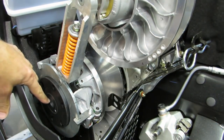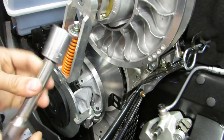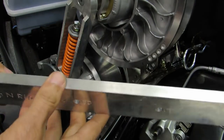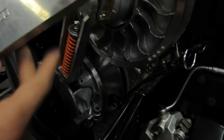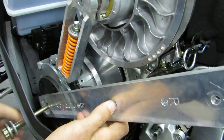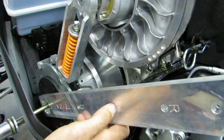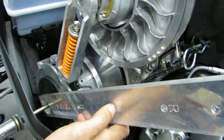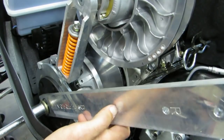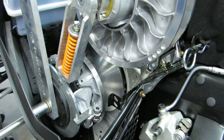I've already taken out the clutch bolt. You take the plastic little cover off the side panel first, then take the clutch bolt out — you need a 13/16 socket with an extension. Here's our clutch alignment bar: it's half inch thick, machined flat on both sides, has a series of holes in it, and a bolt for the clutch bolt. Hold the bar in place, slide the clutch bolt through, and tighten that up. You don't have to tighten this with any tools — just by hand is fine, so you can rotate it and lock it in place.